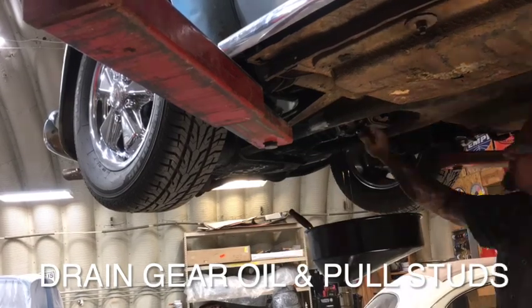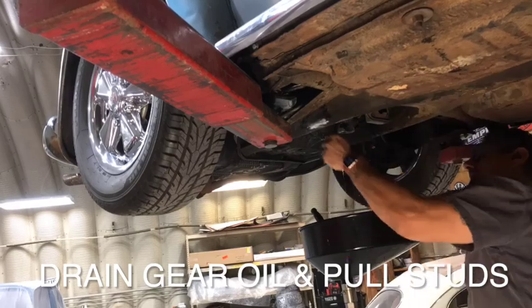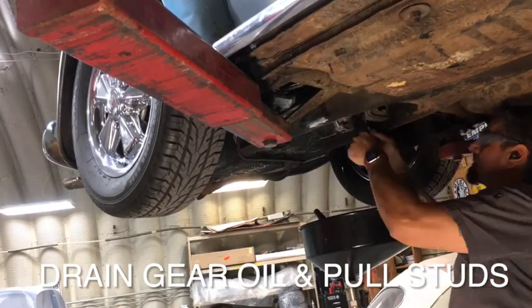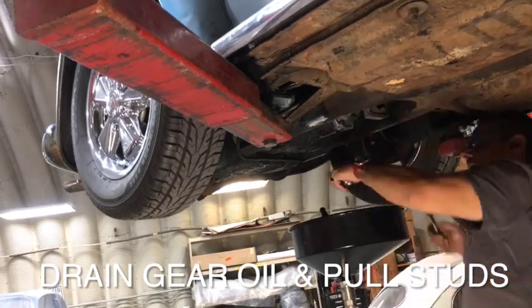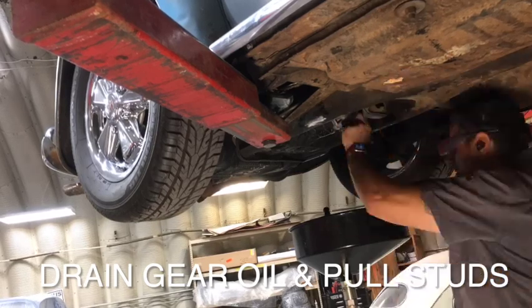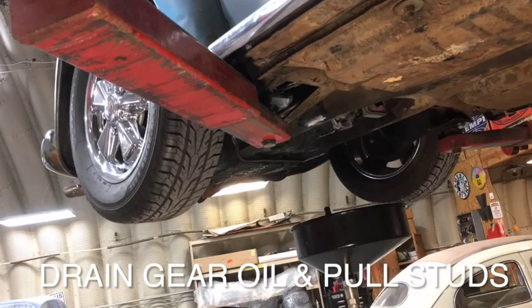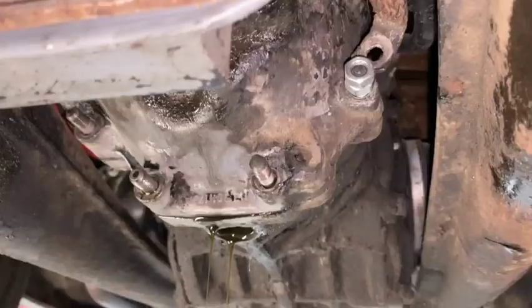You'll be required to install longer studs along the front nose cone of the transaxle so that you can mount the Berg mid-mount in place and stabilize the transmission with no need for a rear engine brace. This is by far the best way to do this. This is the best mount to not have engine noise come inside the vehicle and also not break nose cones.